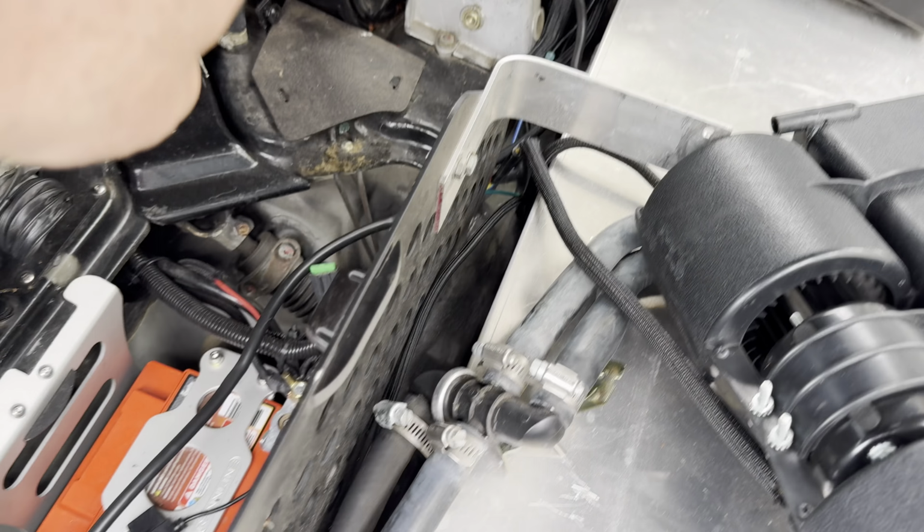I had my old oil pan on there because I really didn't know much about oil pan swapping or modifications. Every time I would launch the car, it would suck up air. Every time I would brake hard, the oil would slosh and I would suck up air. That was basically every day of driving. But one day, I was playing with my quarter mile time and 0 to 60 time, mostly 0 to 60, and then I heard knock, knock, knock, knock, knock, knock. I wiped out all my main journals and all my rods got wiped out. Only one was knocking though, but they were scored bad.